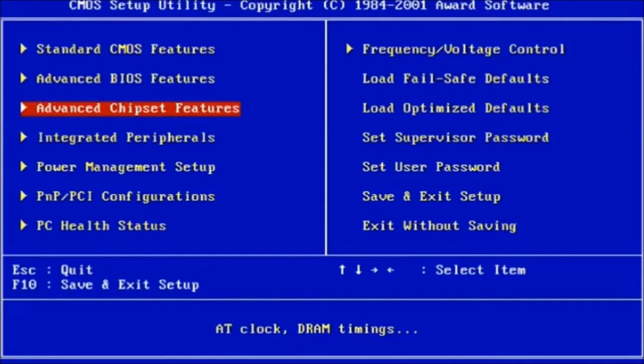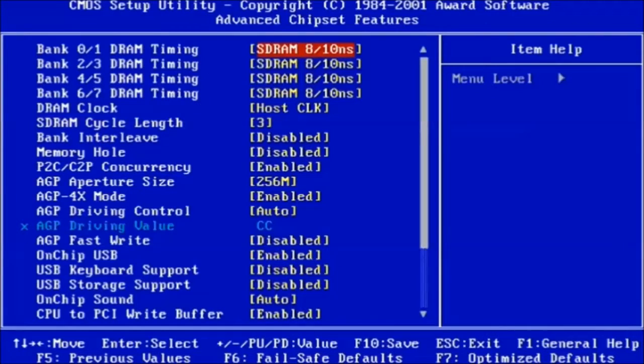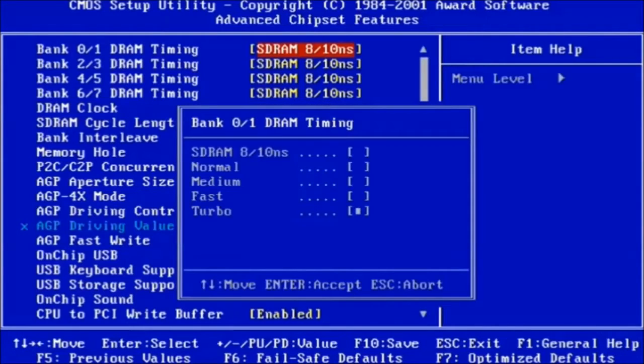Okay, so what that problem was, that was an issue because my card is one of these AGP cards. A lot of the later AGP cards aren't native AGP, so they use an AGP to PCIe bridge in there. So after some poking around, I figured out how to fix that weird problem where it just freezes up and the graphics goof up when you load up XP. You want to go into BIOS and go down to AGP fast write. Oh, I just missed it. I'll go back up there, but actually, I already disabled it. So you want to disable that option, and for me, that fixed things right up. So if you have the same issue doing something similar, even with a different later AGP card, try this trick first. Just go into BIOS and turn off the AGP fast write.